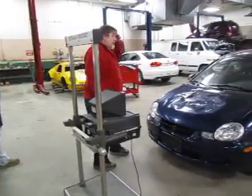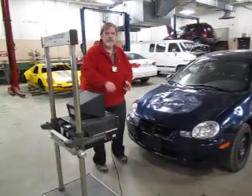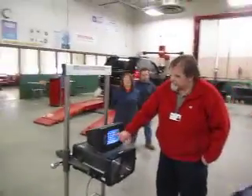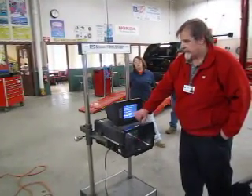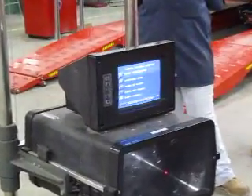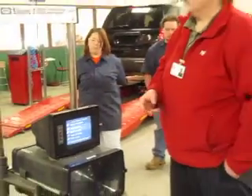I'm now ready to check the headlights. I sweep it down one more time to make sure I'm still on my center point — and I am. At this point I like to level the aimer using the level vial at the back of the aimer. I turn the knob in a clockwise direction to bring it back and level the unit. I've now got it leveled. All measurements will always be done with the unit level. I've got my aimer squared to the front of the car, so the next thing is to turn off the laser using the buttons on the screen.